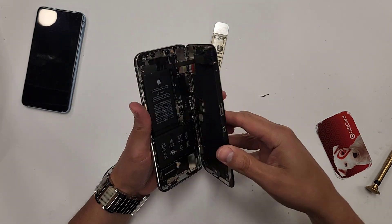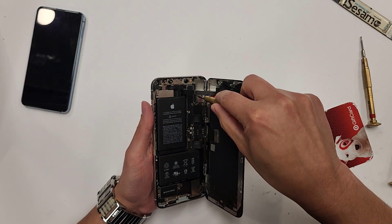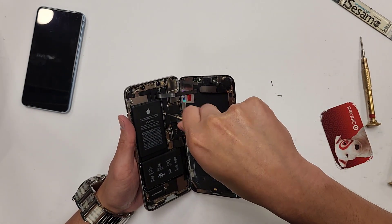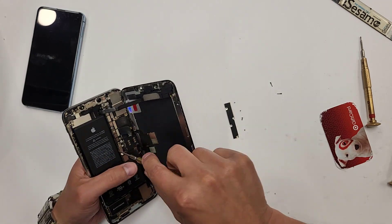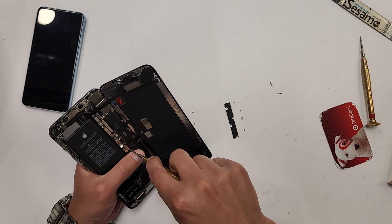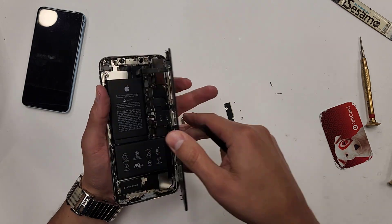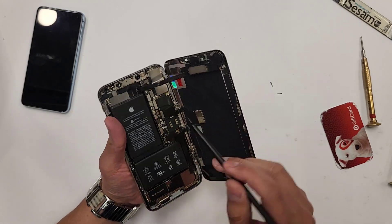I'm taking over at this point with the voiceover. A customer walked into the store and decided to wait inside for their repair. This phone has a total of 12 screws from start to finish, and what I'm doing here is taking out four of them. I lay the shield right next to those screws and keep them in order, because some of them are different sizes. Then I remove the other little metal shield, and since those two shields are out, I can unplug the screen — because those shields cover the screen connections.